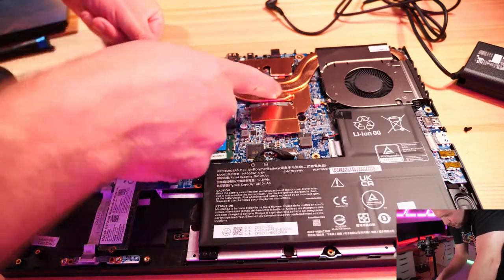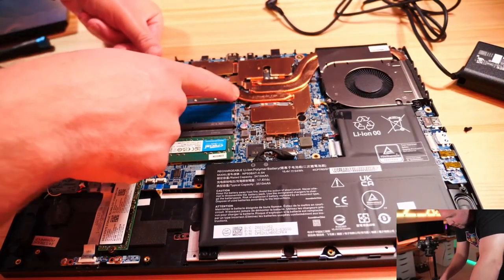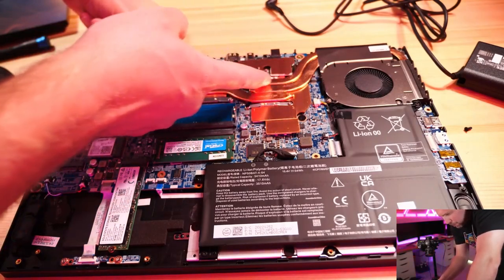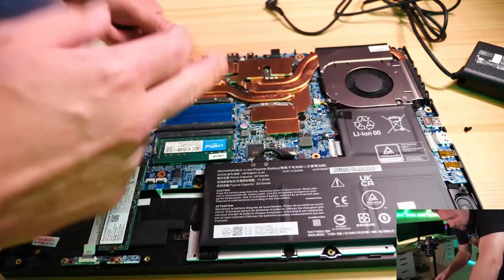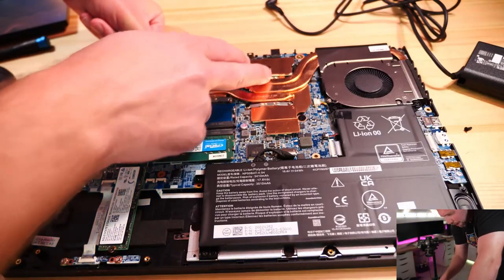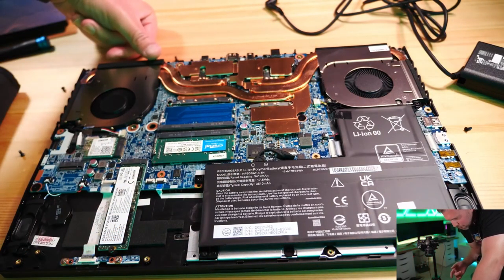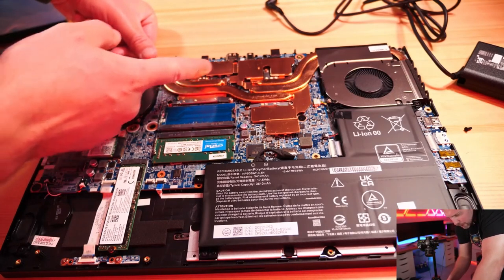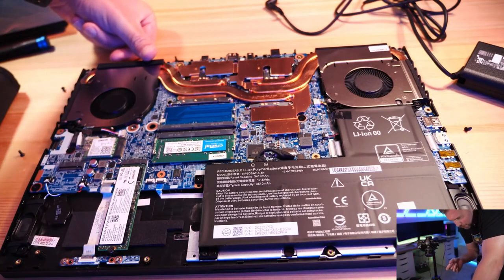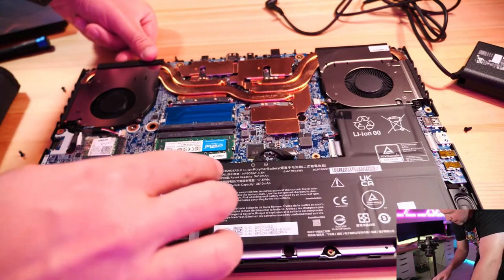We've got the GPU and the i5 CPU, with one dedicated heat pipe to the i5 going to the exhaust, and a big shared heat pipe between the CPU and GPU going to another exhaust. There's also a pipe for the VRMs, and two dedicated heat pipes to the GPU. With only a 75-watt GPU and an i5 — which has fewer cores and threads than an i7 or i9 — I think this cooling setup will be enough to maintain decent performance, though I'm not expecting extreme levels at this $1,100 price point.